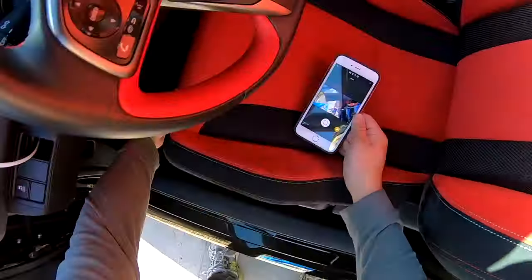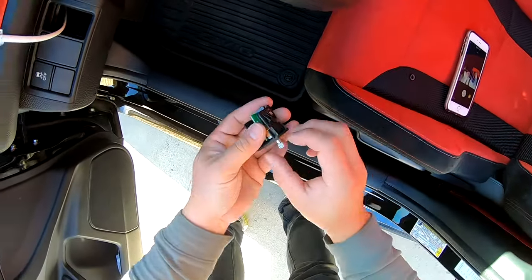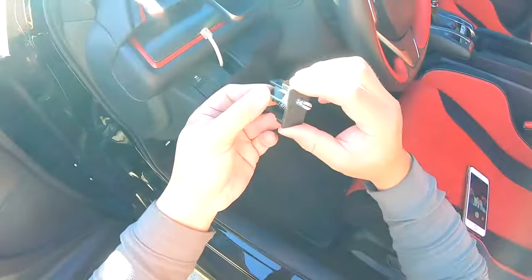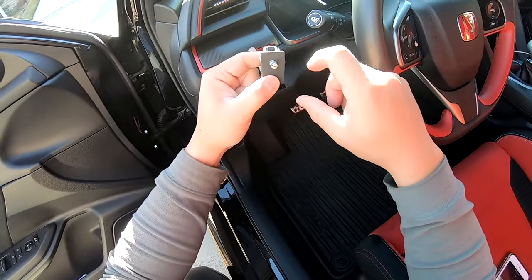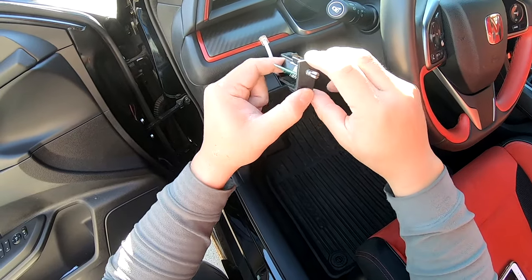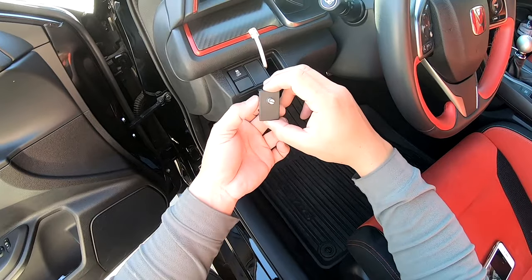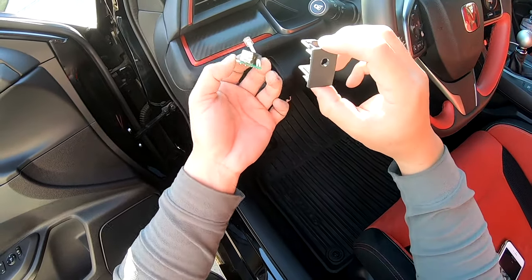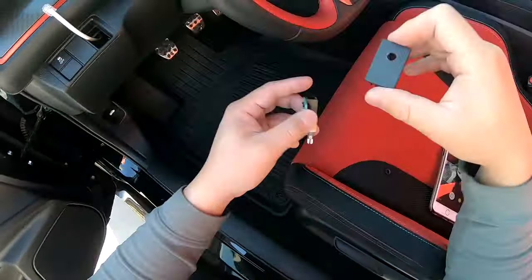So here's a real stupid thing, guys, with the ACR1, is that because of how it sits on the back of the switch blank, you can see, looking straight on, that it sticks out sideways. And so that's going to be a problem because that's not going to clear the dashboard hole very well at all. So not to fret, we can take the potentiometer, remove it, don't mount it in yet.